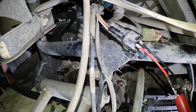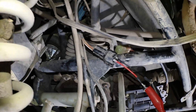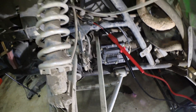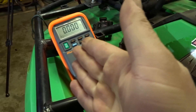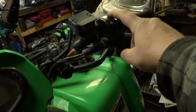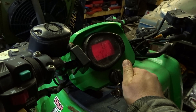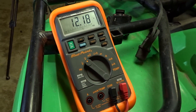For the first test in the wiring harness, connect one lead to the orange wire and the other to the black wire, which is the ground. When you turn on the power the multimeter should read 12 volts. With the meters hooked up, we're in two-wheel drive — turn the ignition on — and we're reading 12 volts, so we're getting power to the plug.